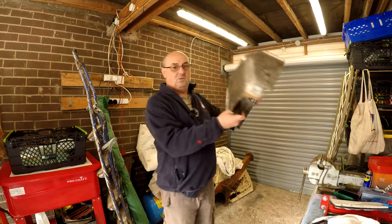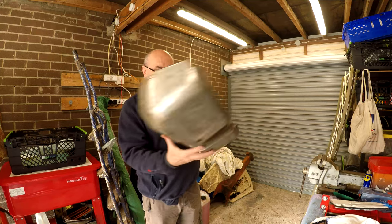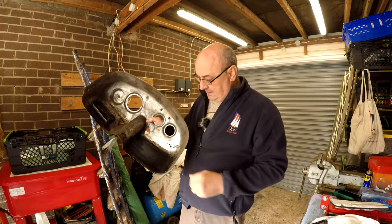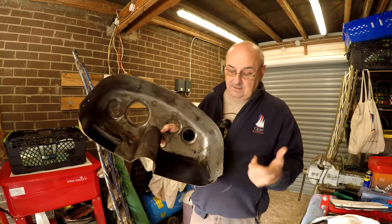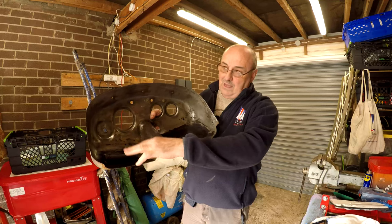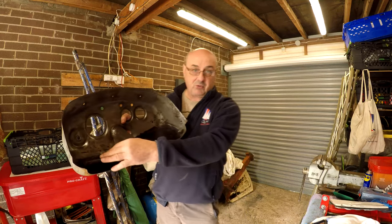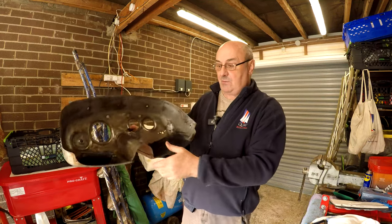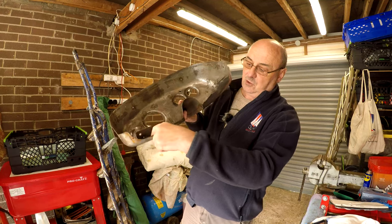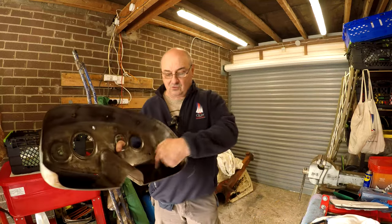What have we been getting done the last couple of days? We've been busy with the dashboard. I've had it in an electrolysis bath for a couple of days and I've just put some Hammerite rust preventative paint on to try and see if it works — I've tried it before on steel and it didn't seem to work very well. I splashed a bit around, especially under the shelf where your old voltage regulator would have sat. There's quite a bit of surface rust in there, so I got in, cleaned that out, and coated it up. It's come up quite well.